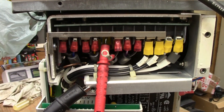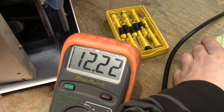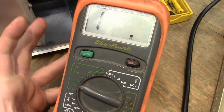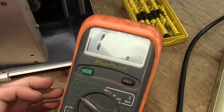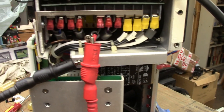I was able to get that terminal loose. There's the 12-volt line disconnected — it's just the multimeter now attached. I turn it on — 12 volts. So that means either with no load the power supply is not failing, or more than likely our failure is going to be on the harness. What is our resistance? It's infinite... actually more like a thousand ohms. That's significantly better. So that's definitely going to be it. If I go from there to ground — three ohms. So, let's go from there.